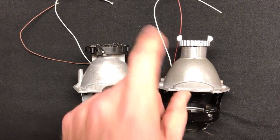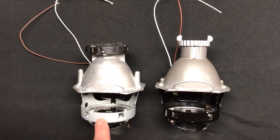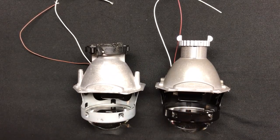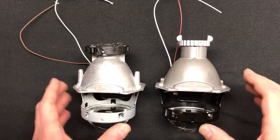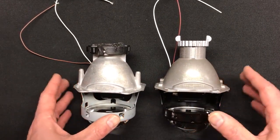In terms of width, we took that measurement at 100 feet and went 15 feet out from either side. The G5 came in at 28 lux and the 4.0 came in at 29 lux, so similar width performance. The 4.0 is going to be a little bit brighter in the hotspot. In terms of overall layout, they're similar in design but different overall takes.